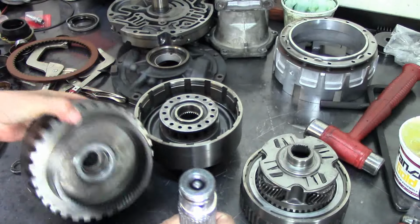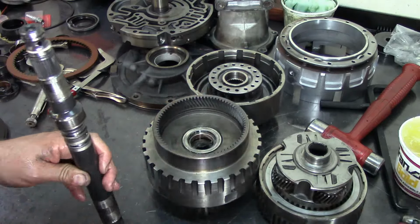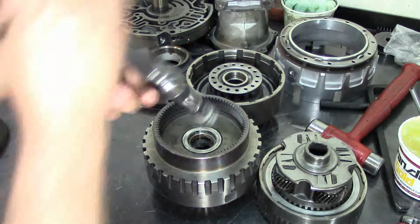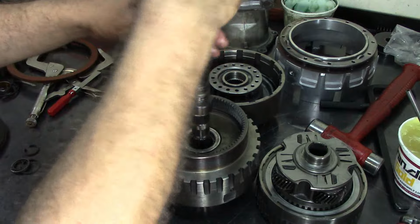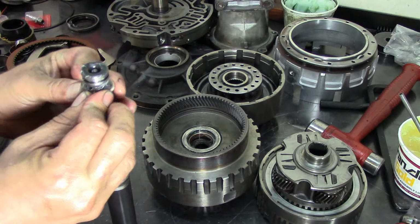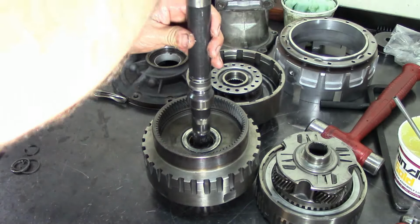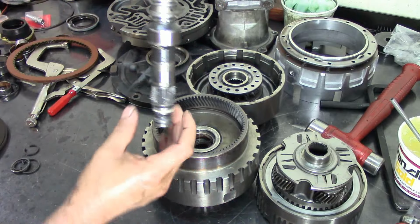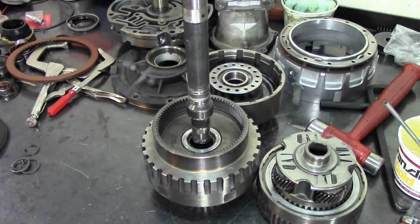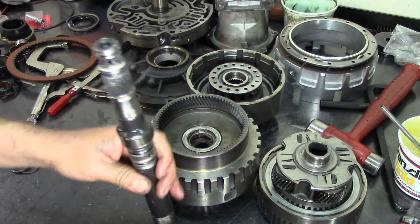Okay. Here's the forward drum. We're going to flip it over like that. Let's go ahead and lube it up. Enough lubrication in there. Let's go ahead and do the same thing with the shaft. Center it like that, and real slight taps. Get it with your fingers. Try to close the sealing ring with your fingers. Guide it in there. If you feel like it's not complying, try to center it again. Little slight tap, wiggle it around, and there she went. In one piece.